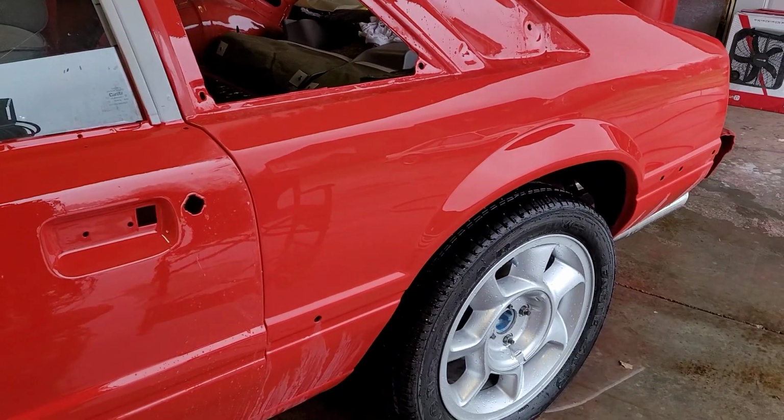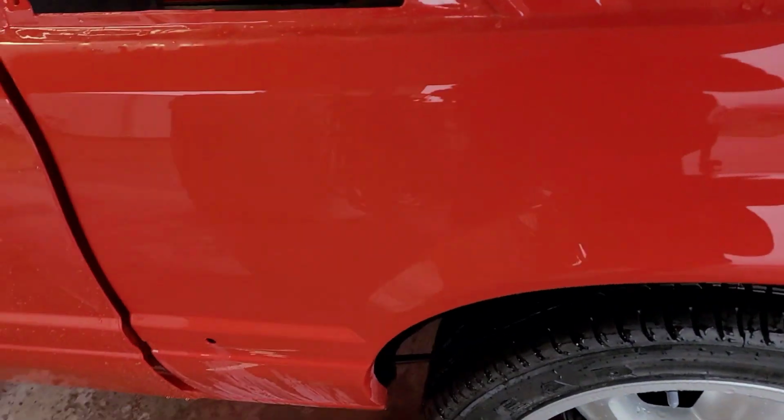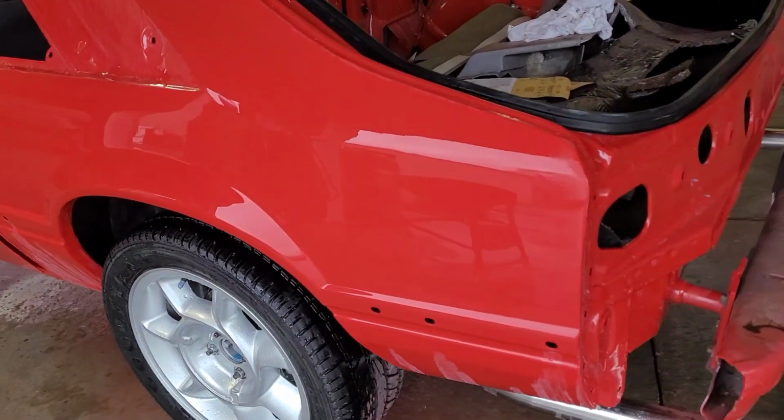Okay, we're back. So those of you who said the run would come out, you were the winner. Looks awesome. I got it wet sanded. I did 1,000 grit, 1500, 2500, and I hosed it down with some water. So it looks like it's basically fresh clear coat. So check it out. Sucker's gone, yo.